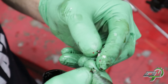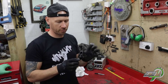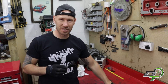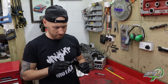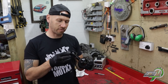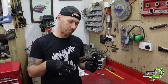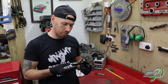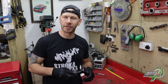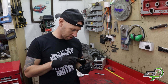Silicon and bearing material swarf - the pickup is full of it. So it looks like at some point there's been a blockage on this pickup, and it's just affected the bearings straight away - probably big ends, maybe thrusts as well, possibly mains. We'll see - we're going to have to pull it apart now we've seen that much debris in there.